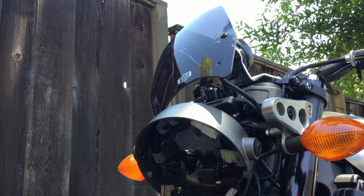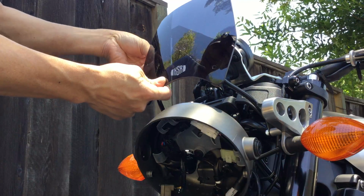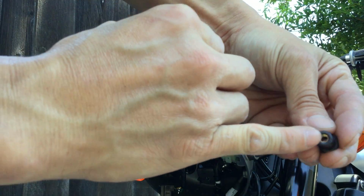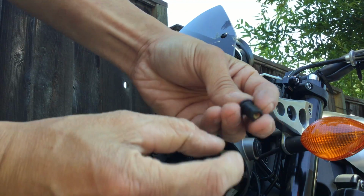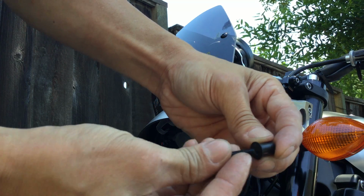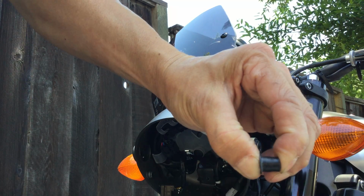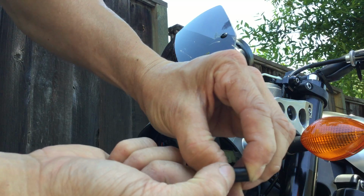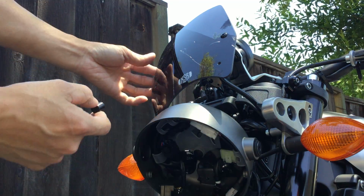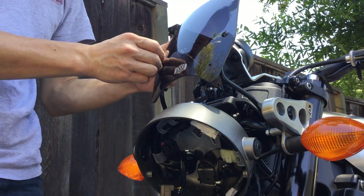So how the button screws work, let me take one out to show you how this works. There's a threaded insert in here. It's only about a third of the length, and the rest of it, there's nothing. It's just the rubber piece. So what happens is when you screw this in, and it catches the thread, and you tighten it up, it actually squeezes this a little bit. And when that squeezing happens, the spot that doesn't have the thread bulges out, and that bulge will prevent it from slipping out of the holes where it slips in. See how that works? It's kind of neat.